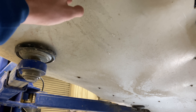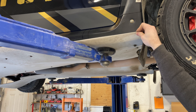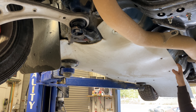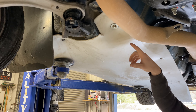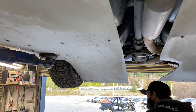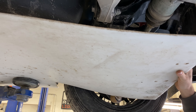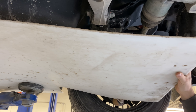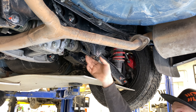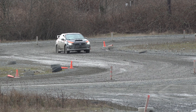There are also wide, long pieces of underbody protection, which are pretty interesting. The material is high-density polyethylene — Dirtfish tells me this is similar to cutting board material, essentially a strong, durable plastic. Most of the underbody protection is fastened using welded nutserts on the chassis, but the back of it is actually attached using zip ties. This flexible mounting allows the plastic protection to move up and down with the rear suspension. At the end of the day, simply snip the zip ties and you can power wash the rear suspension and prep it for the next day. Without this protection, the rear drivetrain and rear suspension would get rashed out from all the dirt and rocks continually pummeling it.